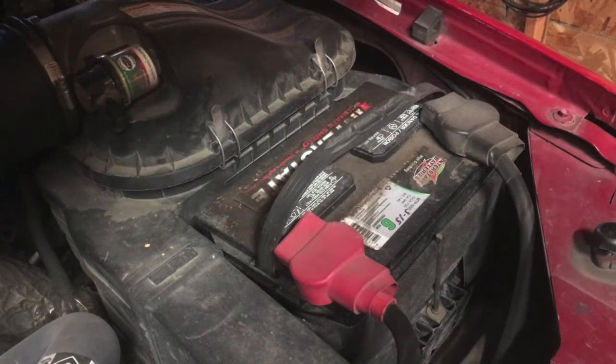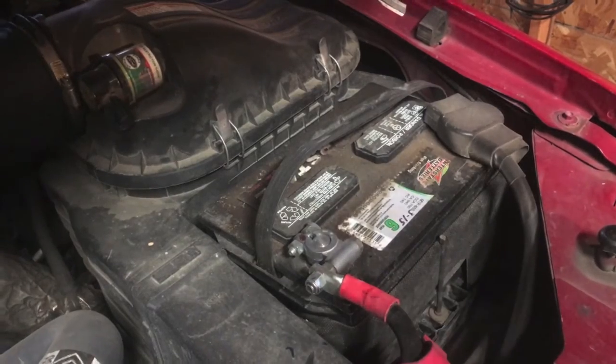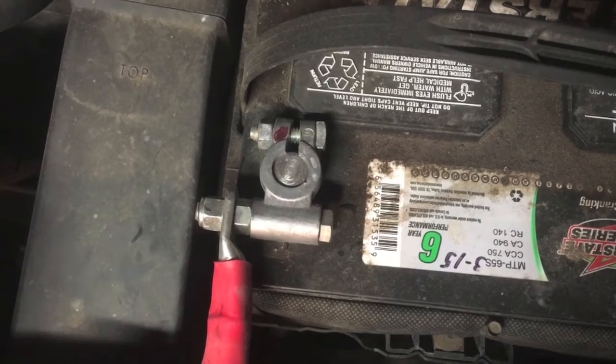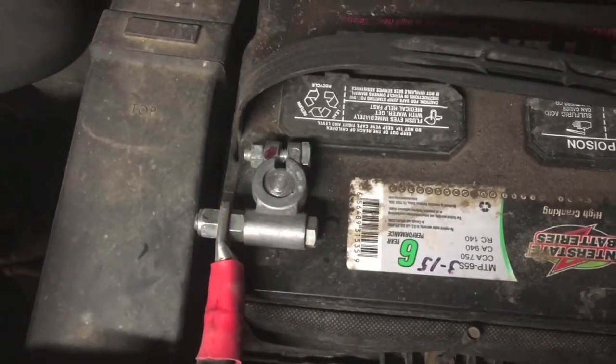The last part of my winch system under the hood — kind of the power source — is my battery cables and battery connections. If you're using the stock batteries in most pickups, you probably have a top-post battery, and it can be pretty difficult when you want to start adding accessories to those. So I bought these add-on terminals here. They're not the cheap marine terminals — these are much higher quality. You can see they have a 3/8-inch bolt that goes clean through, and they're a whole lot thicker and can carry a whole lot more amperage than those little marine terminals you see at Walmart and auto parts stores. I'll put a link to these terminals down in the description as well.